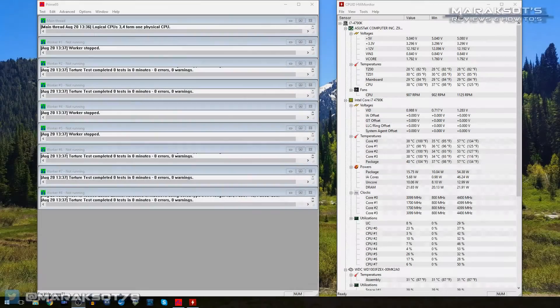To see whether or not reseating my CPU cooler and using the Noctua thermal paste is making any difference, we're going to need a baseline number to go off of. So I've opened up Prime95 as well as a hardware monitor so I can look at all my core temperatures on my CPU. I can also look at the core clocks and see what frequency they're running at and check for any throttling. But mostly, we're most concerned about the temperatures for now.